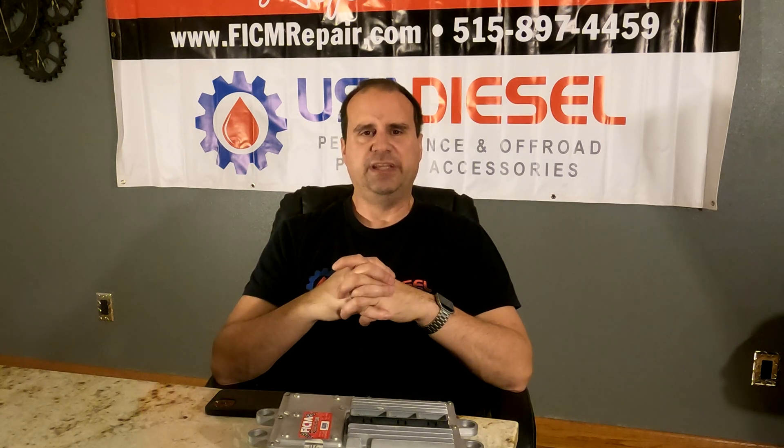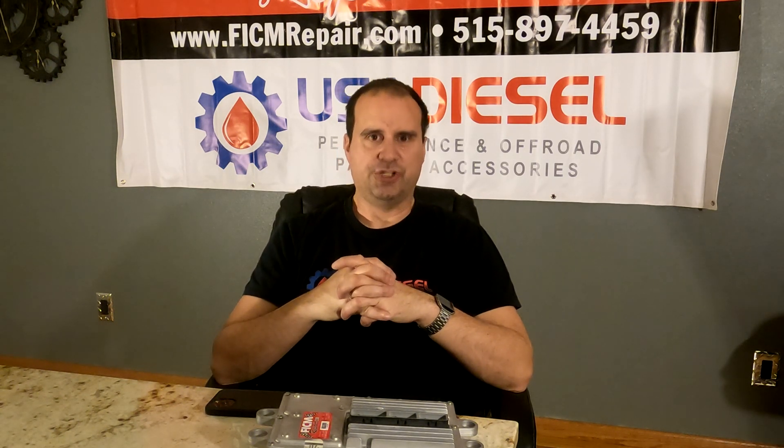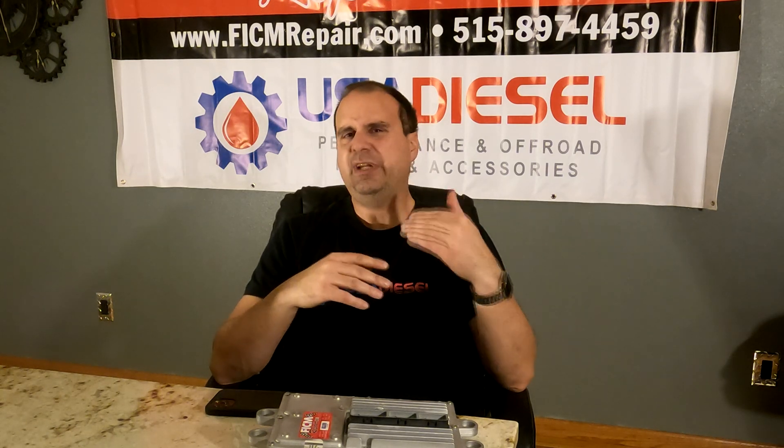Here's what happens. It's about 1,350 amps of inrush current to get your starter spinning — holy crap, that's a lot of amps — and about 300 amps to keep it spinning. It can take up to three minutes of combined starter engagement time in order to purge enough air out of the high-pressure oil system to allow the truck to start.